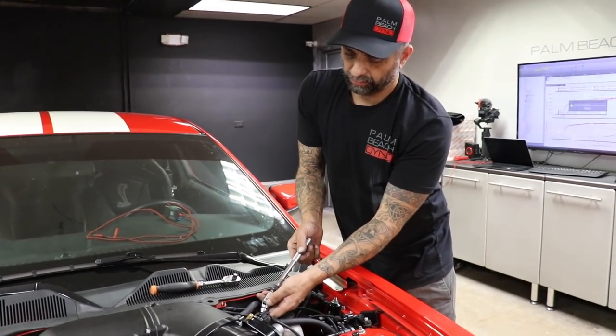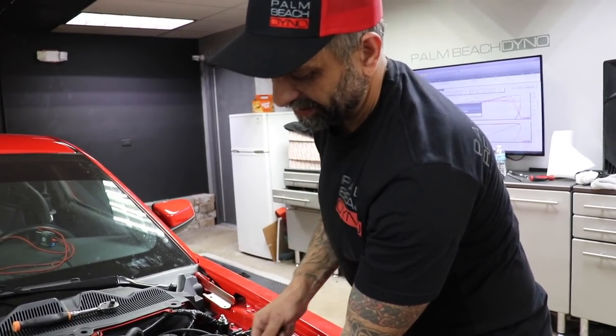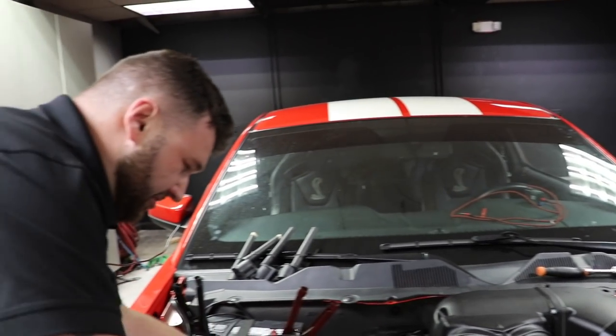Let's film this. We've got Ken and Rob. Better feel special here — not just on the keyboard today. I got you working today. Alright, spark plug re-gap — 3.5, 10% lower again. It looks like we've already pretty much been at the same power as before. Obviously we've got a major power decrease on the dyno with the rear tires, but hopefully we can buy a smaller pulley and turn it up a little bit more.